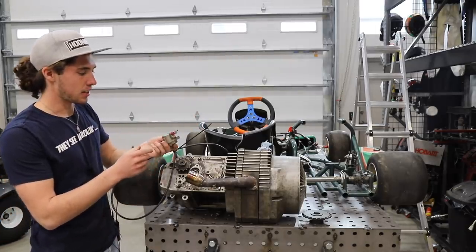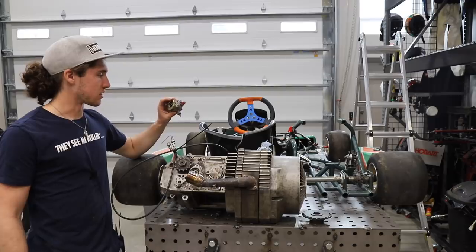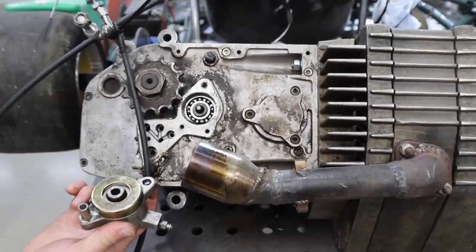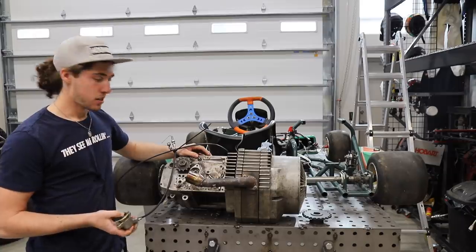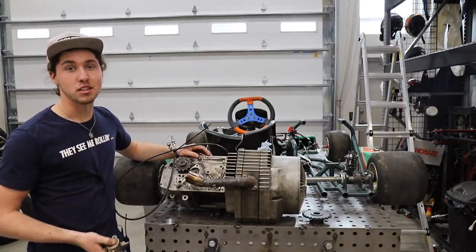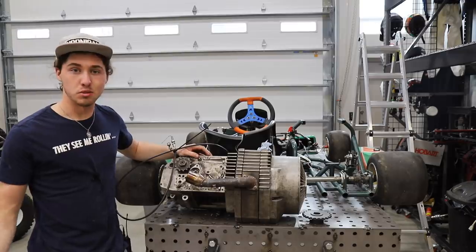And then also, the clutch has given us so many problems. I'm sure if y'all have followed this thing, you'll remember. We're gonna try to replace the old mechanical style with the lever that always got stripped out with basically a hydraulic slave cylinder and master cylinder. That's gonna be a lot of custom work. We're probably gonna save that till the end though, because I have not been looking forward to it. So let's just start with the re-gear and the seat, because that stuff I know we can come out on top of.